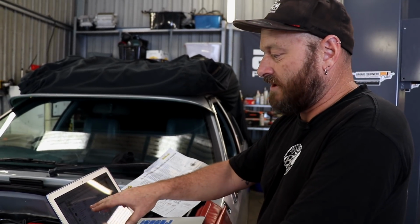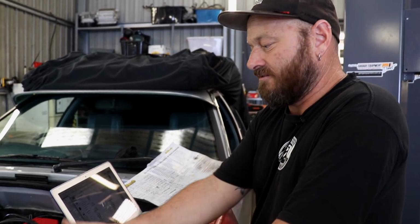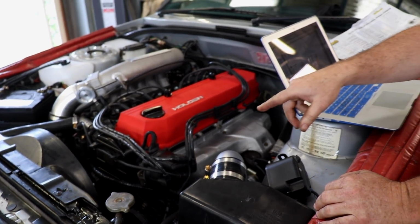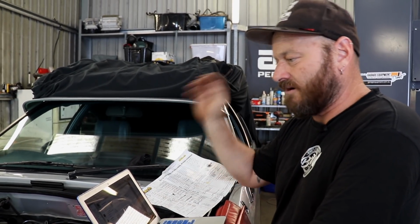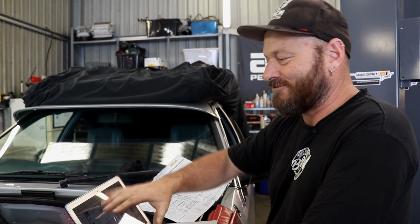Of course you have to do your offset angle. This has a distributor, and the distributor can be rotated. That's not how I would do it. I've just set it up in the middle. The offset angle can be adjusted, so you don't need to touch anything mechanically. Generally, it's pretty right. Again, don't try and start the engine just because you've got the trigger pattern selected. That's not how it works.